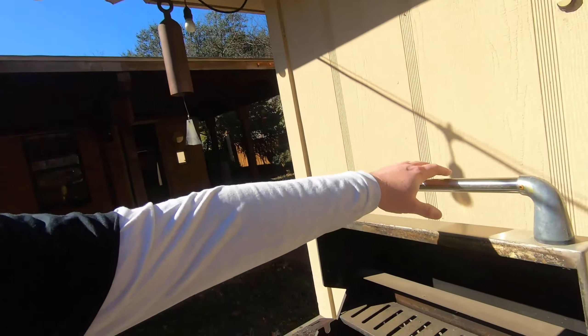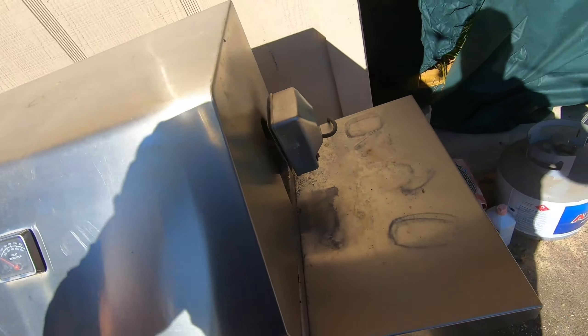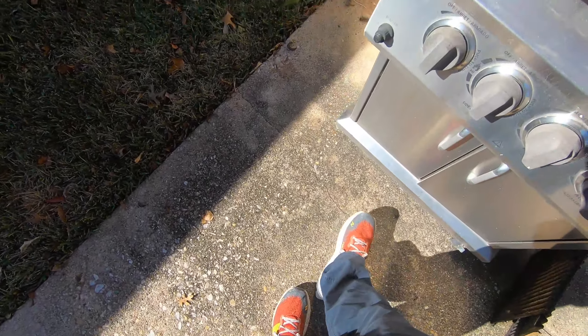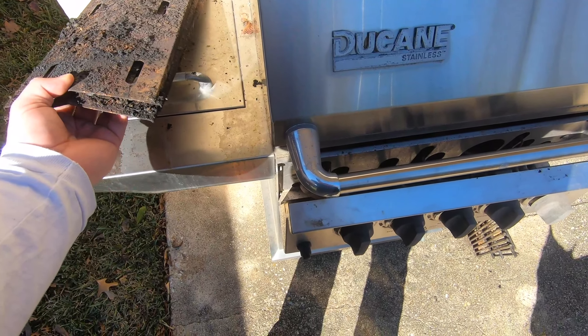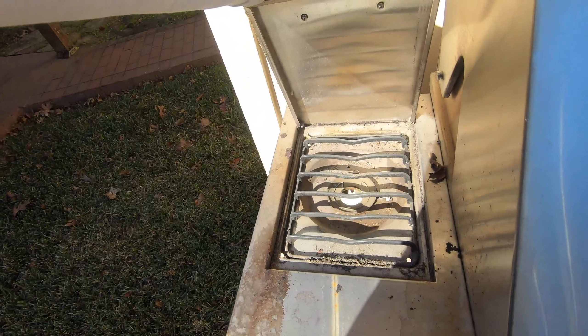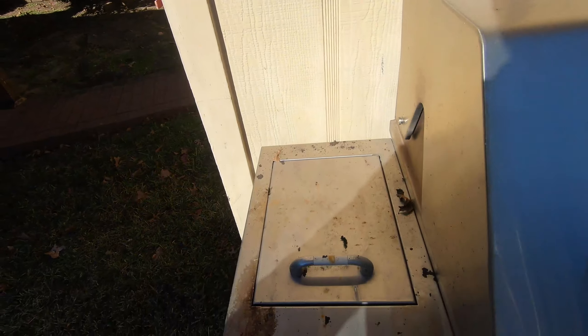I'm going to take everything apart. I'm taking the lid off, taking the handle off, the thermostat, the logo. I'm going to take the little side shelf off. We're going to look at the side burner here after we get rid of these things. It's got this little side burner — I don't think this thing works, I'm going to try and take it apart and clean it up as much as I can. All of the stainless steel is going to get sanded. We'll start with disassembly, then degreasing, then we'll sand the whole thing down. Then we'll use a self-etching primer, which is just spray paint that self-etches and bonds with the stainless steel.